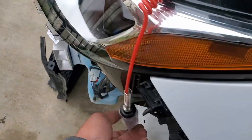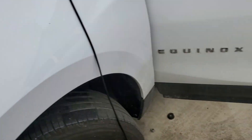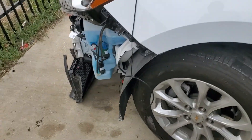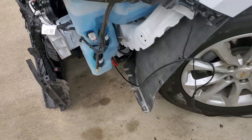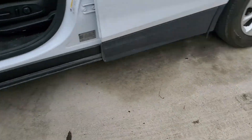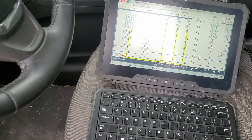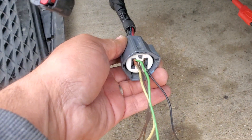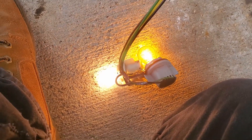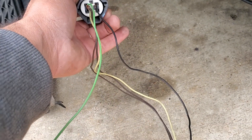I tested this with an LED light, but because my incandescent test light is out I can also use a bulb, which I have. Let me make sure the power and ground are able to carry the load. When I plug my lights in, I have good bright lights. That means the power and ground are sufficient to carry the current needed.